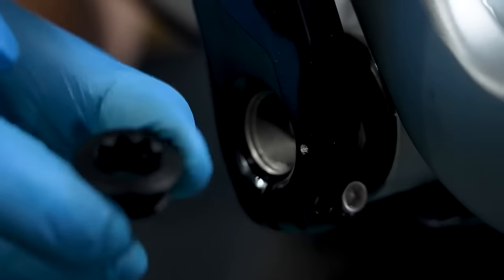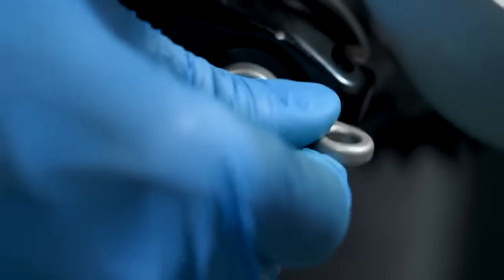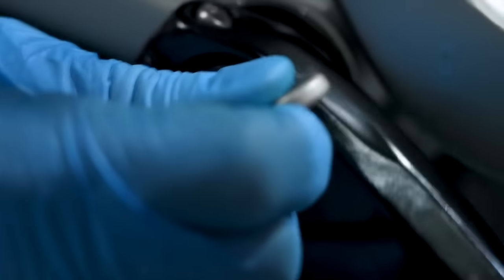One of the things I've always loved about the Shimano bottom bracket system is just that simple preload cap. Now, there's a few different tools you can use for this, but I love using these simple ones. You just have to be careful not to score the crank on the way past, but it means you can easily preload it and get it just right.